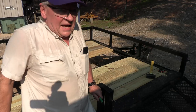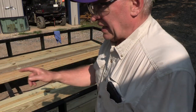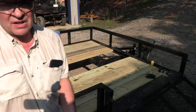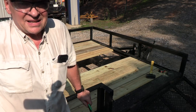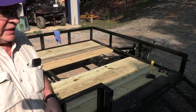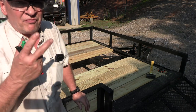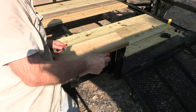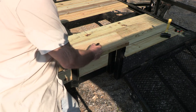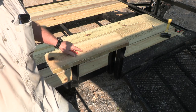I've got eight of the planks on the trailer. The distance between one end and the other is 14 feet, and I measured the one intact board I took off — it was 14 feet minus an inch — so I've cut these to that length. For the last two we need to do a little trickery, getting into the flexion of the final three boards in the center. For the seventh board I just needed to take a little edge off, and that got me to where I wanted to be.